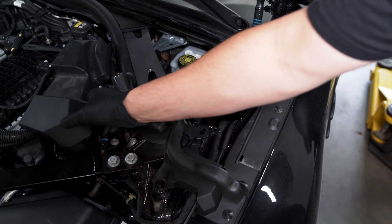After that, you have the harness coming across, routing below the harness here behind the fuel pressure sensor and over the valve cover corner to the secondary wastegate — you'll see it plugged in here — and the bank one primary over here. So that's the routing for the electronic wastegates. As you can see, it's basically installed like OEM — you cannot see the JB4 from here, so very clean. There is also a sub-harness that connects to this little connector on the JB4 that powers it, and you will have to run this through your firewall. This little male connector plugs into this section of harness — make sure to get it the right way, there's a little tang and finger that will go together. There's a little plastic sticker you can pop a hole in and go right through the firewall to the OBD connector.